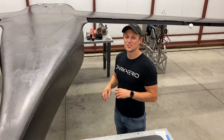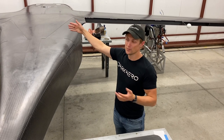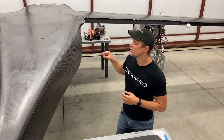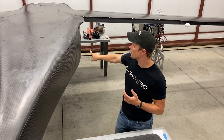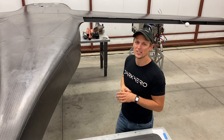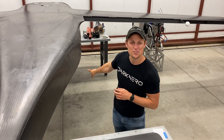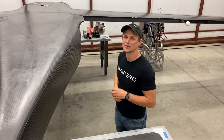Another task is installing the fuel lines that run from the wing root — or the tanks at the wing root — to the fuel sump. It's easy to do that with this inverted because you can just pop up underneath into the fuselage rather than leaning over and trying to reach all that stuff. You can basically set a stool under there and climb up and access everything.